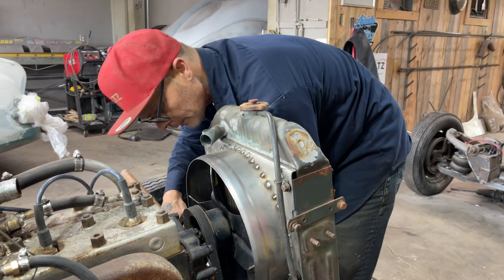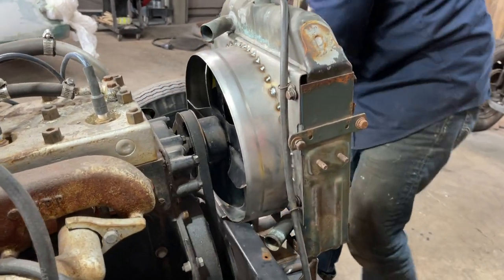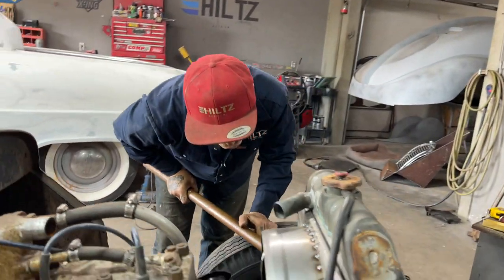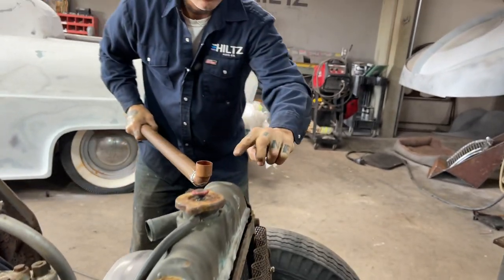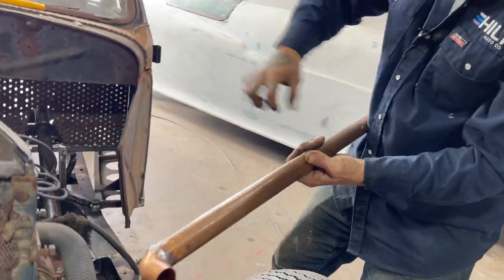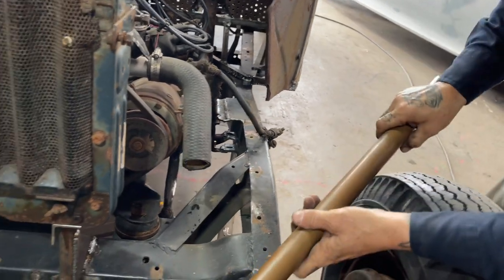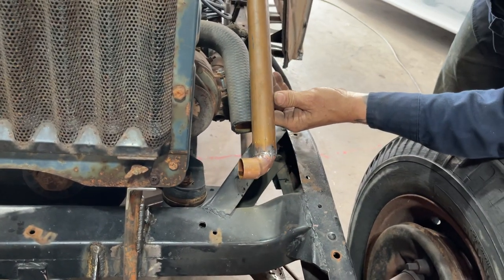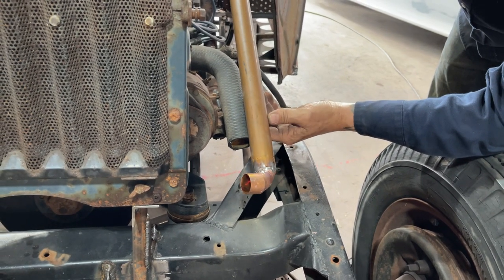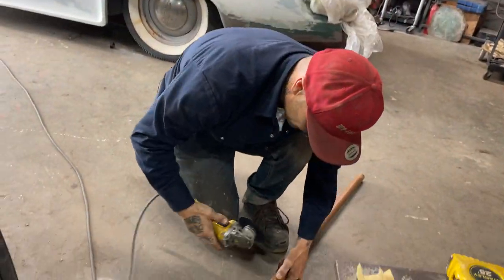Sometimes this is harder than you think. Because I have to solder one elbow on that side, and I have to solder one elbow going this side. It has to be connected with a piece going in that way. So I can do this, cut that off, and solder another 90. Let's cut this off, and then I'll go for another one.